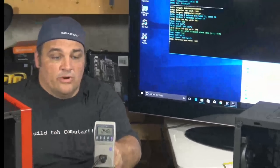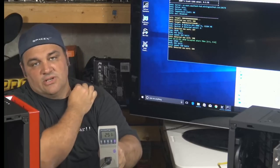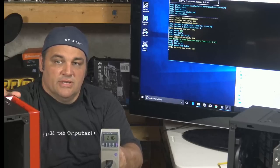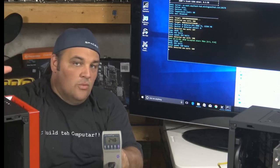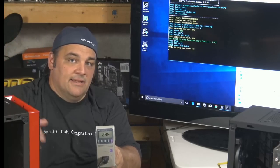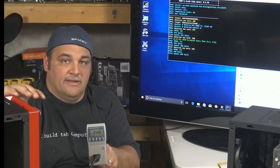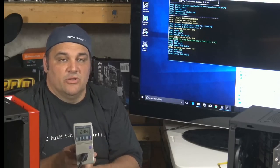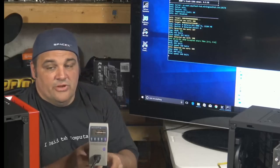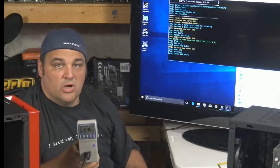We're about 650 sols here and power hasn't moved — moved maybe one or two watts. We're almost back to stock. You can see what happens with that power underclock — you're essentially having to really overclock it to get back to where stock was while having a lower power target. If you want to drop it from 324 down to 250 on just one card, this is really good for folks that are gamers. If you get home from work, game for five or six hours, and then want to run this thing at night — this is kind of the one-card example — at a 1080 Ti you can hedge a little at night and get some crypto.